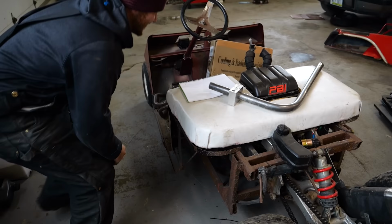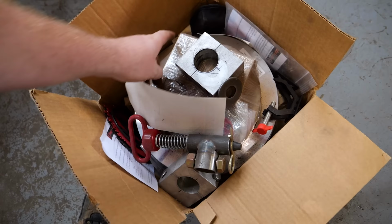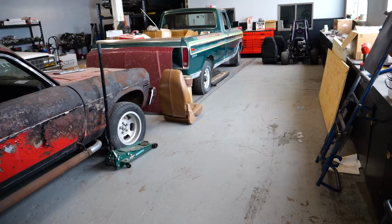We'll have to dust off the old Rogue Fab tube bender. I think we've got a box of dies and stuff here that we never even finished opening, from the looks of it. Yeah, 1 inch. Was it 1 inch tubing? 1.5 inch tubing is what we're doing for the main hoop, and then possibly 1 inch for like a radiator mount. You have any 1 inch tubing?